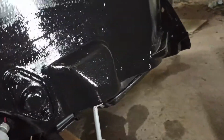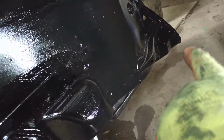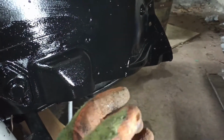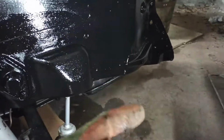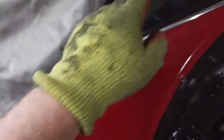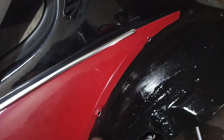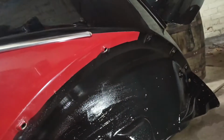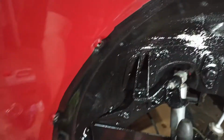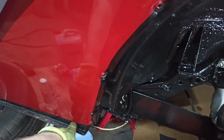Got a bit of paint in mind, so I've gone down here with the paint with this box section, which is for the bumper brackets. I'm going to get in here. I've had some really good success with a little hose you get for your spray can, and it sprays 360, so you just go in and out with it. I've done that with all the chassis and all the roof parts and all down here before. It worked really well. So I'm not too concerned about the heater channels, because it's all spray painted in there. I do need to sort bits of this out though.